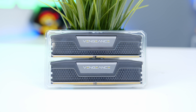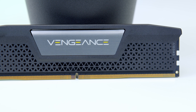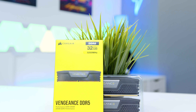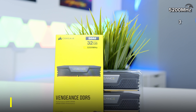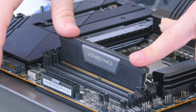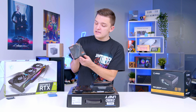Into the motherboard, I'll also be installing our RAM. This board is a DDR5 board, meaning you need the latest, fastest DDR5 memory. DDR5 is admittedly still in its infancy right now, allowing you to get fairly similar performance results with DDR4. With that being said, we're still recommending DDR5 for any of our i7 or i9 builds with these 12th gen processors. For this system, I've had to pick up a low-profile kit of Corsair's Vengeance — I would have used their Dominator Platinum kit, but it's too tall for the cooler I'll be using today, which also ties into the stealthy all-black idea.